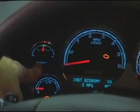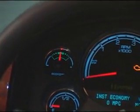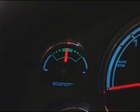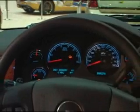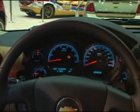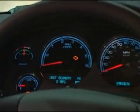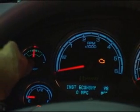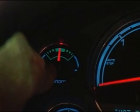And then finally, there's an economy gauge. And what you'll notice here, it's a very simple gauge. It's got a needle pointed at 12 o'clock. If you can keep that needle pointed between 11 and 1 o'clock, that solid green band, we're maximizing our fuel economy. But in the instance where you need power, that needle's going to swing far to the right, indicating that you're compromising your fuel economy, but you're getting the power you're looking for. And likewise, if you brake very hard, you're losing the opportunity to recharge through the regenerative braking system. What's happening there is we're dissipating heat out into the environment, losing that opportunity to capture that inertial energy and recreate electricity to charge the batteries. So if you learn to brake and accelerate smoothly, you'll actually adjust your driving style and maximize that fuel economy you're looking for.